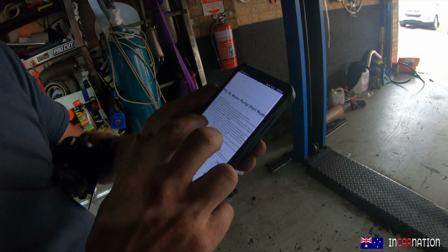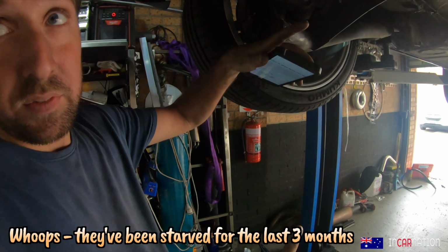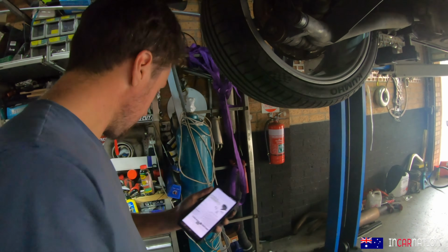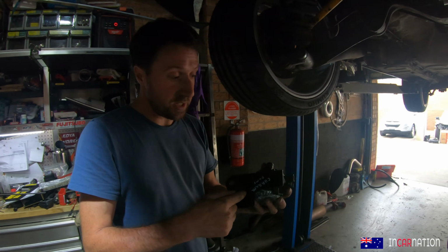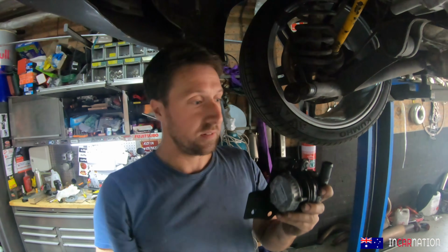Just says here, ensure the mounting position ensures that pump will never be starved of fluid. The bottle will be this far above it, and it says on its side, pointing to the sky. Okay. Terrific. Just not upside down. Thank you for checking that. So we can run it. It's super easy. If I trim this bracket and point this up to the sky, it's almost at the top level. We just run a 90 and it goes straight to the inverter. Okay.